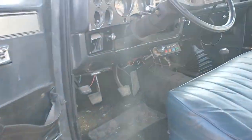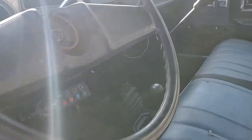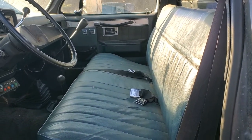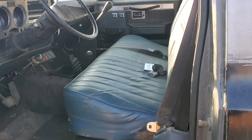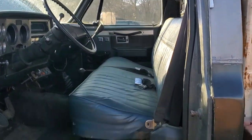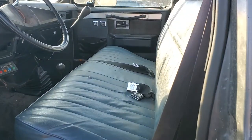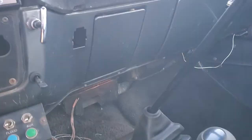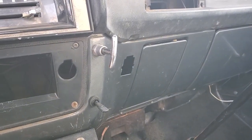Let's go ahead and give it a start to see how it sounds. I just disassembled and cleaned up the interior — most of it is original except for the seat. The seat is a rear seat out of a Suburban; all you have to do is change over the mount brackets and some other bits and pieces and they bolt right in. Much better condition than what you find in most truck seats. I added the glow plug switch and kill cable because this is a manual diesel.